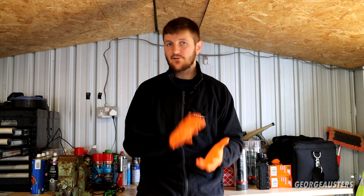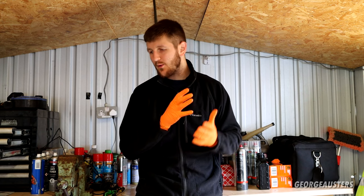So there we go — this has been pretty successful. If you notice that one or two of your washer jets on your BMW, especially your BMW X5, are not working, there is a good chance that the filter on the pump itself inside of the washer fluid reservoir is blocked up. Once washer fluid sits for a long time, it seems to gum up and those filters get completely blocked. The best thing you can do is remove the pump itself and then clean out the filter physically. But especially on the X5, it is a massive pain — you're probably going to spend the best part of a day just stripping down the car to even get to it.